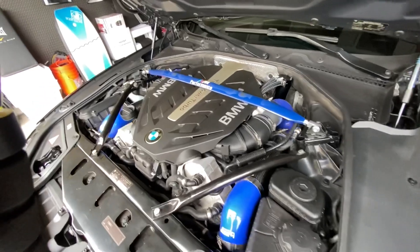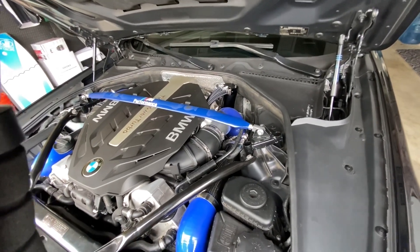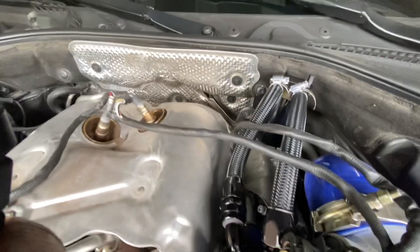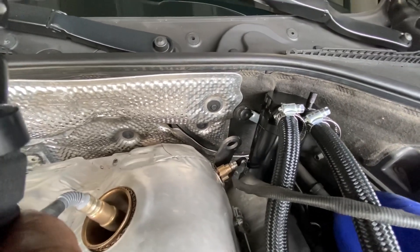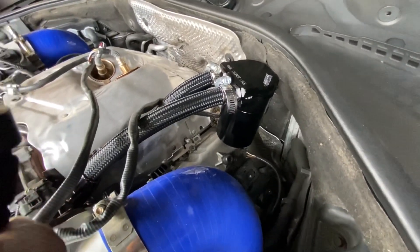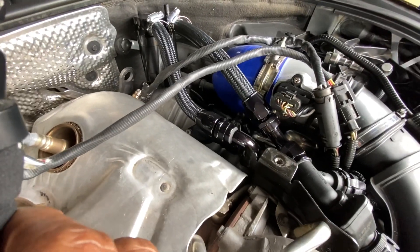It's all going to be based on the intake system you have in the car. If you have the stock intake, the catch can is almost impossible, but there are several different intake setups that make it possible. I'm going to show you the one that worked for me after hours of searching YouTube. I've got my catch can on a bracket because it will not fit where the engine hooks go to pull the engine out. The space is a little tight, so you can see I had to put a bracket in on this side. I'm using braided hoses coming down to AN-5 fittings — I'll give you a close look at those.